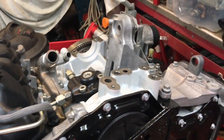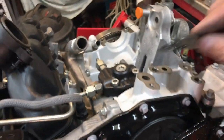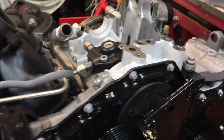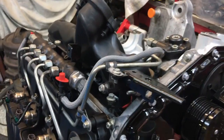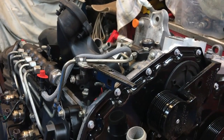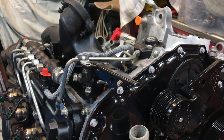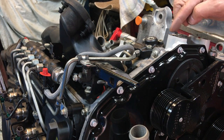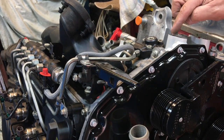All you've got to go in there is a gasket, like so. The gasket goes in between the water pump and the block. I'm going to use a drop of Hylomar, as you know I like to do, and that should help make things a little bit better. I'm afraid you can't really see very much here, but I'll leave the camera on anyway. So I'm putting a drop of Hylomar, making sure my finger's clean first, on the block face, just a very light smearing.